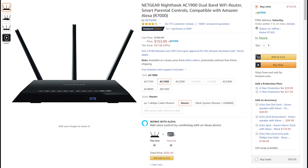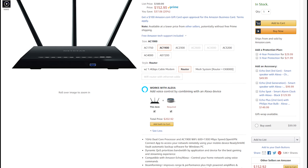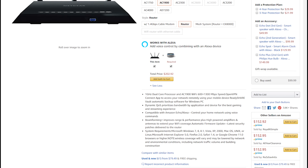While the device is being updated, let's talk about what makes the Nano HD different from an off-the-shelf wireless router. I'm going to compare it to the Nighthawk AC1900 from Netgear, which is a pretty good home-based network router and wireless access point. The Nighthawk retails for about $190, though I've seen it as low as $140. It's a do-it-all device: it provides DHCP and DNS, connects to your ISP, and has features like parental controls. However, as soon as you need more functionality or expandability, the Nighthawk starts to fall short, especially on wireless hardware.